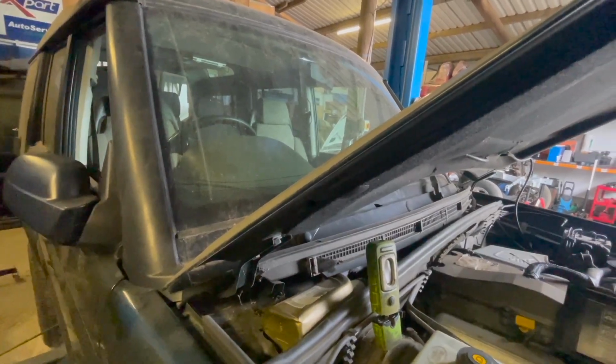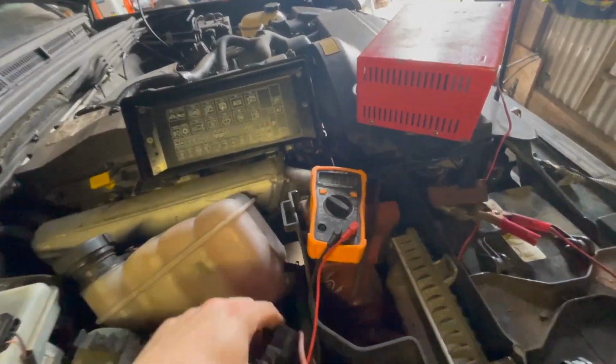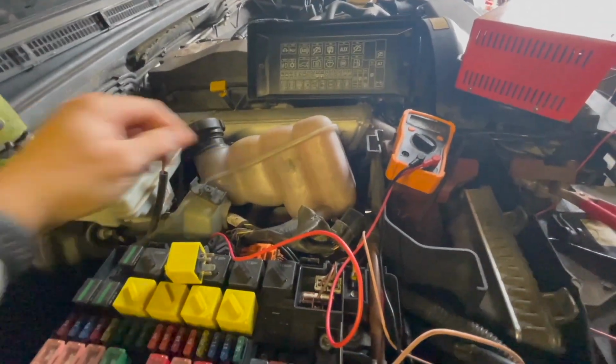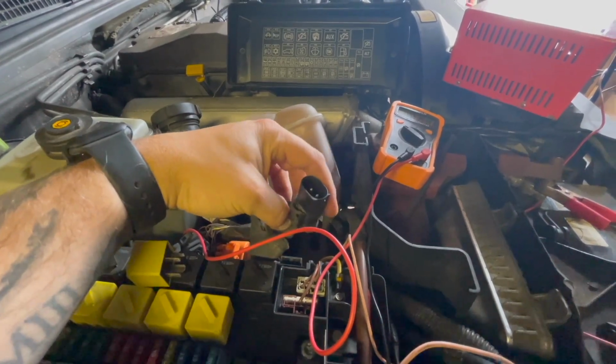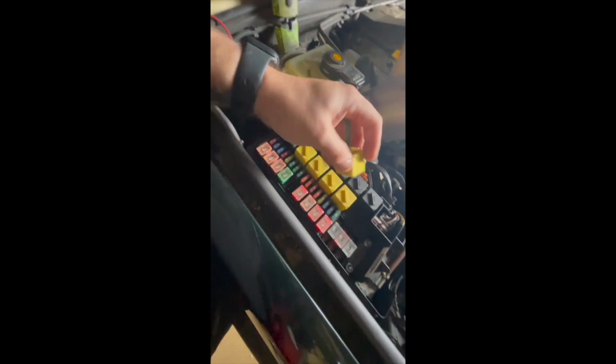The fuel pump's going. So we've simply not plugged something in. So I've just got to find the other end of that plug. And job's a good one. Right. There's the other end of it, tucked under there. So with that in, we can put the relay back in, and we can do the bleed procedure.